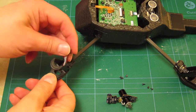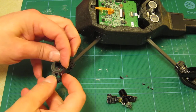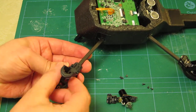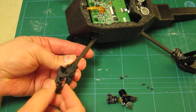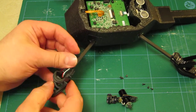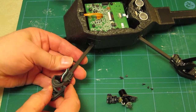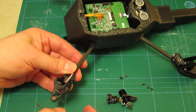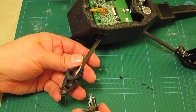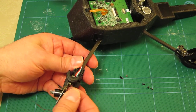This is the last one — I'll show you what I do on each one. I quickly pop the cable to this side of the foot and give the cable a good tug to make sure I've got all the spare wire slack that's in the arm. That's useful for when you hook it back to locate the connector into the motor circuit board.